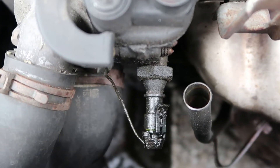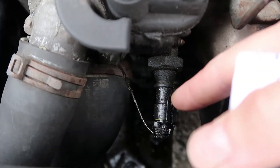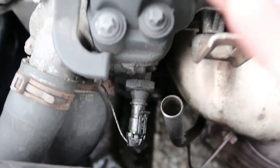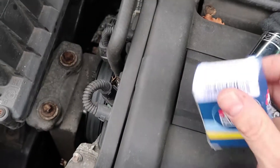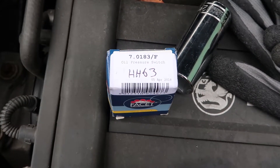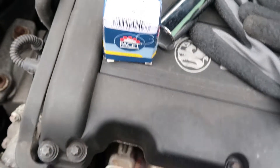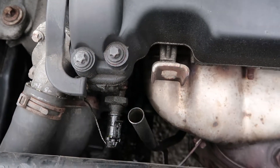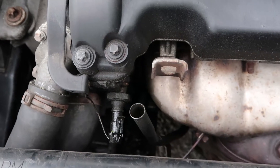There's your offending article, so you're just going to replace that. This little clip will pop off right here, you'll just pick that clip up, loosen it off the engine. Here is the part number that you'll want. Oil pressure switch — you need a 24 mil. Pop that out, keep the clip, keep this cable bit, screw the new bit in. Very, very common problem on these Tigras or these little 1.3 whatever engines.